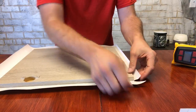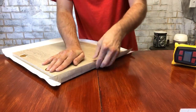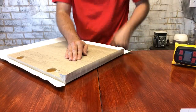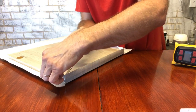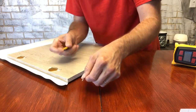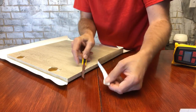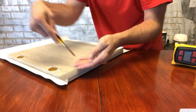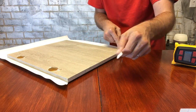Top of doors — I do top doors first. I'm going to overlap it again and slowly lock it in. Now I'm just going to put my knife on top and try to be careful not to cut the other vinyl. I'm doing a 45-degree angle cut — actually a 45 this way and a 45 this way, so two 45s. This slices instead of going straight across, giving it a smooth slice.